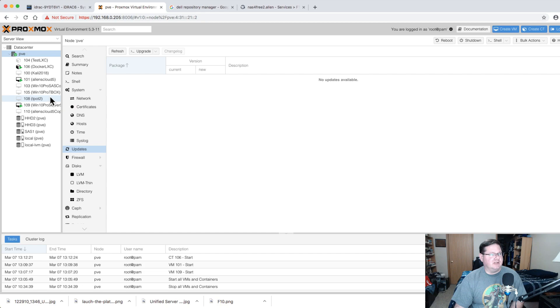With all of that shut down, the fun began. I tried my normal ways — reboot the server and try to connect to ftp.dell.com. There are a few different addresses: downloads.dell.com, ftp1.us.dell.com — several FTP sites that have worked in the past — and I couldn't get any of them to work. I then tried going to the Dell website, downloading individual updates, and trying to get those to execute and run, but I just couldn't get that to work either.